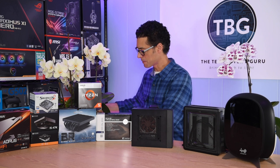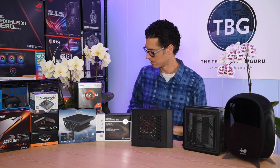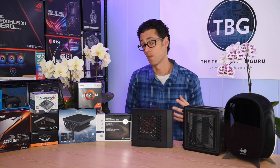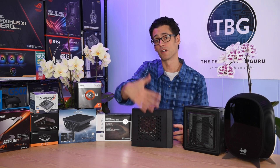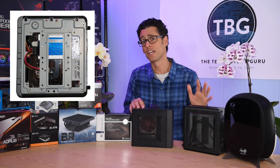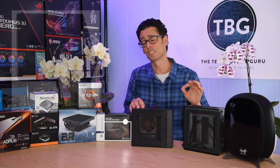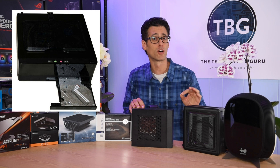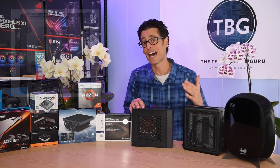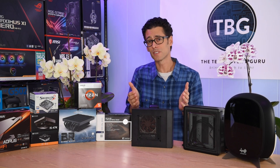While a lot of people are probably excited about being able to optimize and customize this to their heart's content, my concern is that all that modularity comes at the expense of performance — because they layer all those trays right on top of your CPU. That makes this case really different from the ISK110, which layers its SSDs behind the motherboard. Similarly, InWin has a BQ656 case that allows a slot-loading or tray-loading optical drive behind the motherboard, not cutting off airflow to the CPU. The ML10 gives you all these options, but it cuts off that airflow.